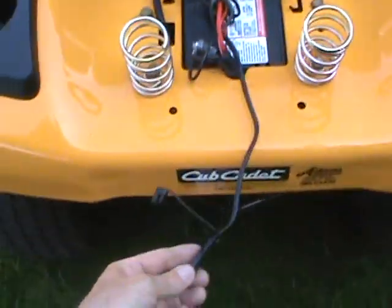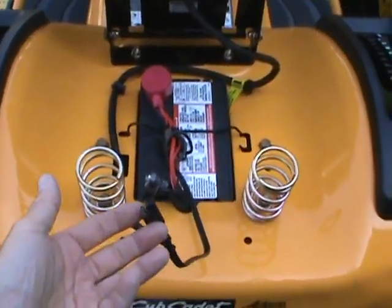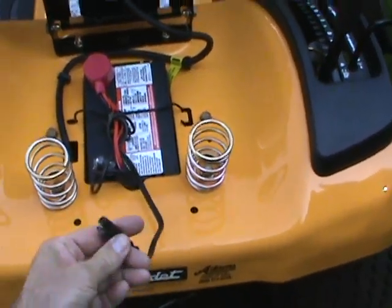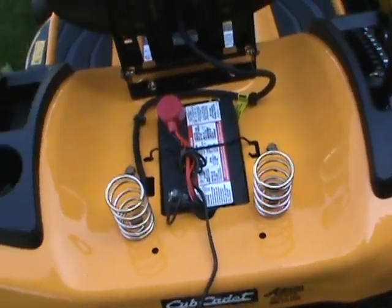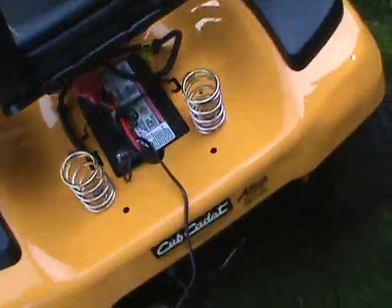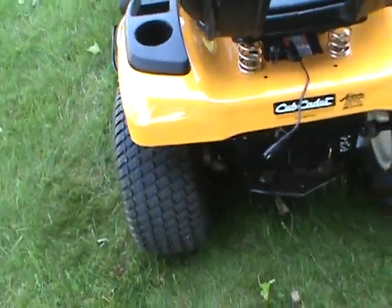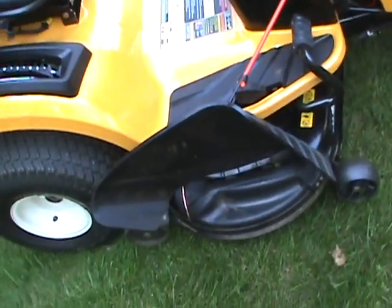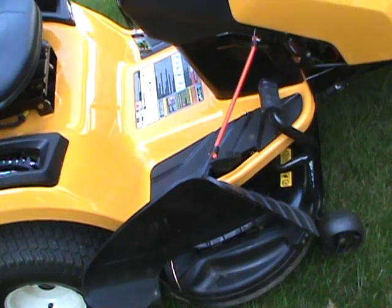I have a pigtail coming off the battery, and what I have connected is a Battery Tender Junior trickle charger that I always plug into these machines. So when they're sitting in my garage unattended, I know when I go back to it it will fire right up. Also, the batteries tend to last a lot longer too.